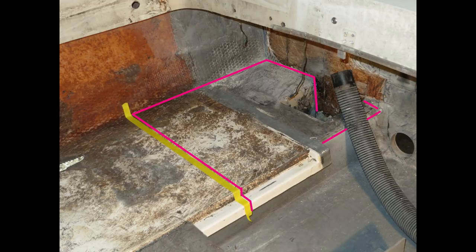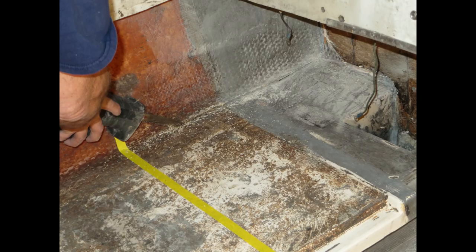You can see where the red lines are — those are the cut lines where we're going to cut the floor section out. My tool of choice for cutting these floors out is going to be a reciprocating saw or Sawzall using an 8-inch construction demolition type blade. You're only cutting through a 24-ounce woven roving tape along the side — it's not that thick so it's going to cut pretty easy and this saw makes very little dust.